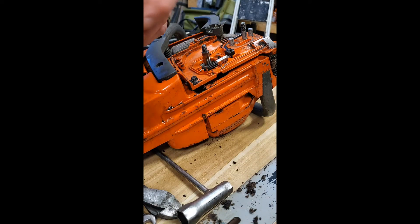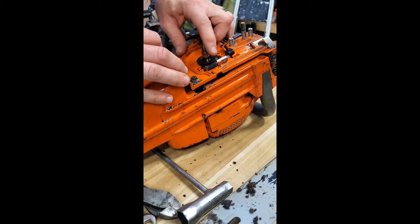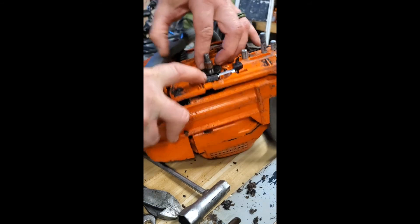Got that cleaned out really well. Until the saw comes back I really won't know if this is fixed since he doesn't use this saw a whole lot, but I'm feeling pretty confident in the repair. Just clean this up really well, drop that seal in there, and make sure that while it spins it turns that gear. You can see I spin this and it's turning the pump gear.